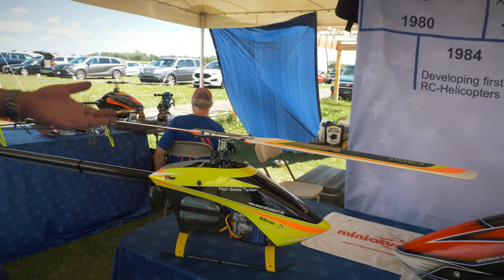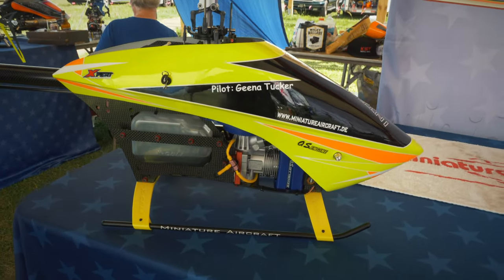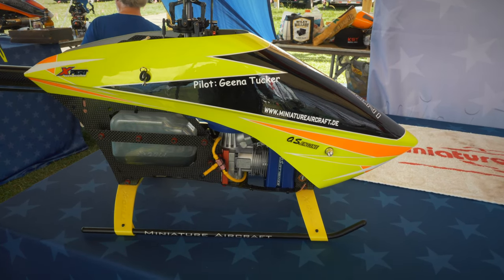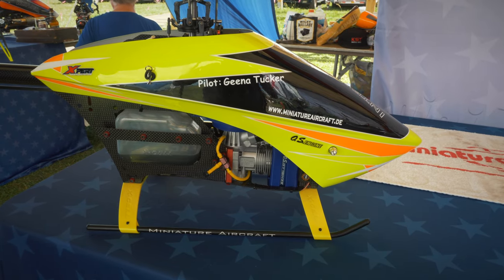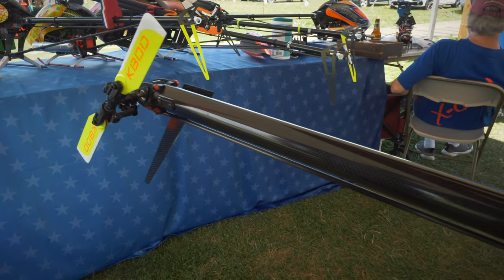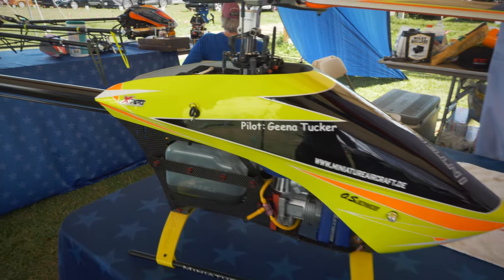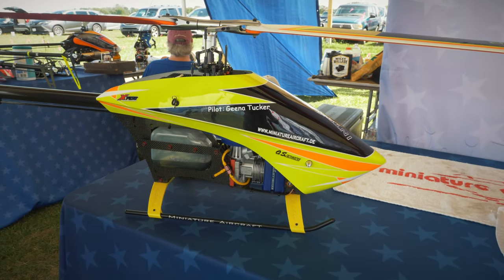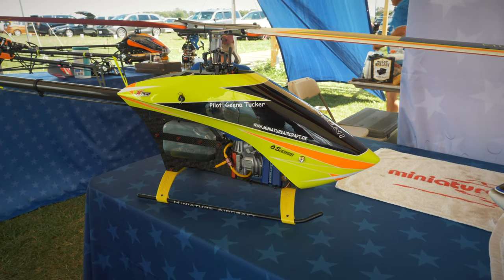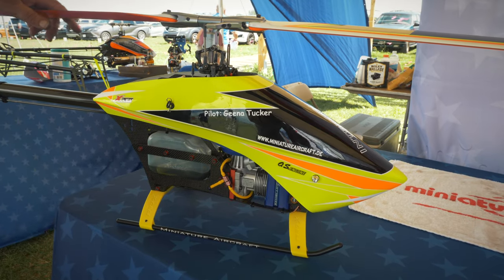The cost for fuel and oil is nearly nothing. And the power of that engine — it's a 91 engine, a 15cc engine — has a little bit more power than the OS55. The OS55 has something like 2.1 horsepower, while this engine has about 2.7 to 2.8 horsepower. So it compensates the slightly more weight this engine has with power and with some longer blades.